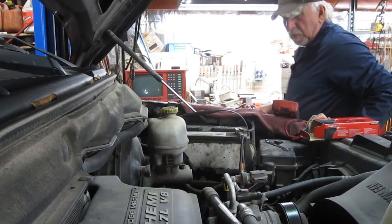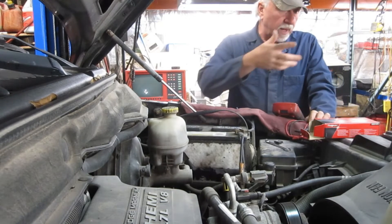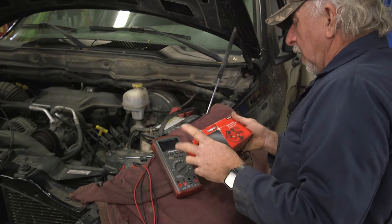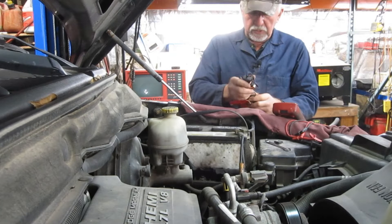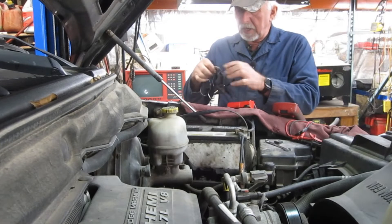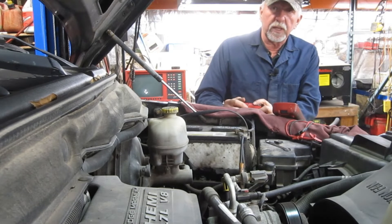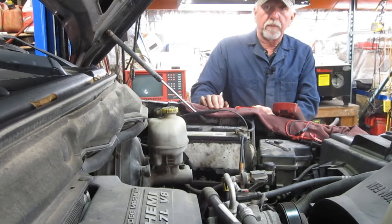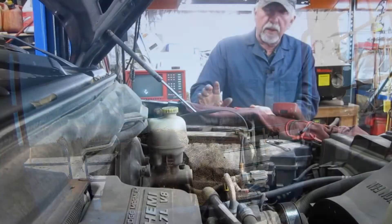For a relatively small investment — a high-quality meter, an auxiliary battery, and the Snap-on parasitic draw test harness — I was able to get in very successfully. We've done a lot of these. In fact, we're not done here because I have a skid steer that's also drawing on the battery, and I need to address that too. There's nothing more miserable than going out in wintertime to feed the cattle and finding a dead battery — so that's the next item I'm going to tackle.